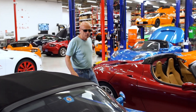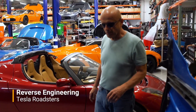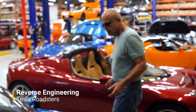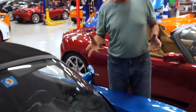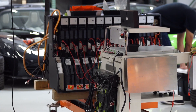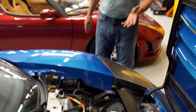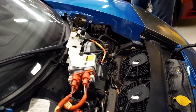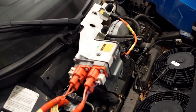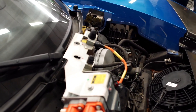Welcome to Gruber Motor Company. This car came to us with a pre-charge problem, and generally that could be in one of three areas: in the PEM, in the ESS battery pack, or in the 400-volt HVAC controller. In this case, we found that the problem is actually isolated to the 400-volt HVAC controller.